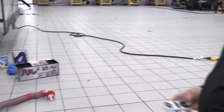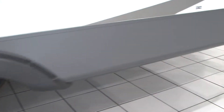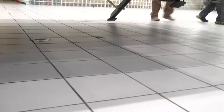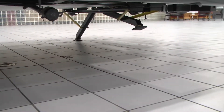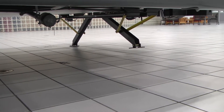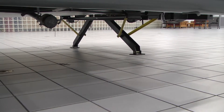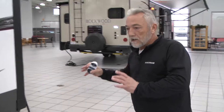After the front stabilizer goes down, then you can lower the rears. This is basically just to keep the trailer stable. So this is the third process: side to side first, front to rear second, then drop the stabilizers. Lower them down to where you get a nice, good, firm contact that'll keep the trailer from rocking.